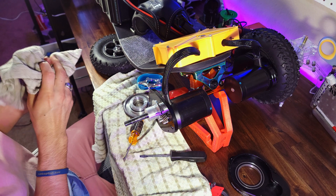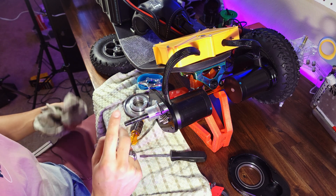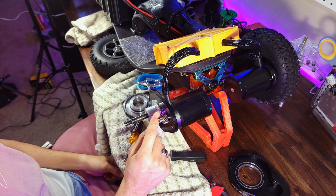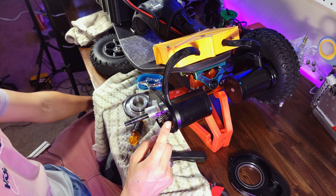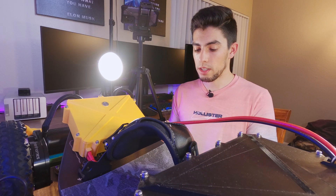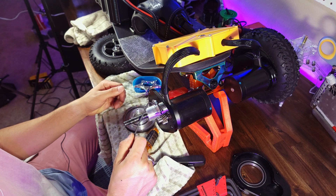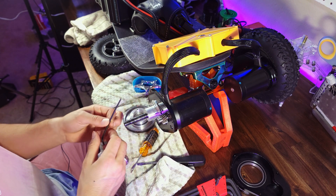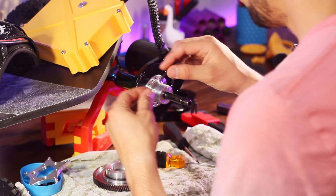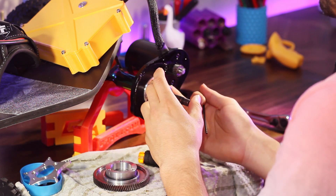The next things you'll see are the four screws that hold the motor on. You'll use these four screws to adjust the backlash of the gear set. To actually get this off the drive, you need to take off the three M4x8 screws on the back side of the mounting plate — you can see them peeking through in three positions. Reach around, take those off, and the plate will come free from the adapter; then your adapter will slide off the truck.